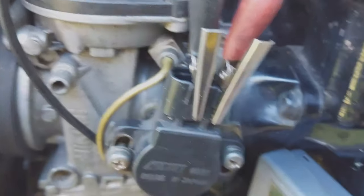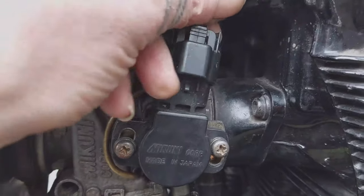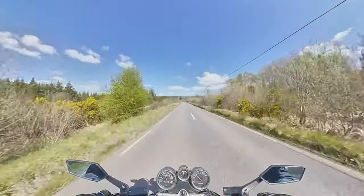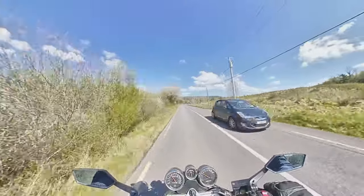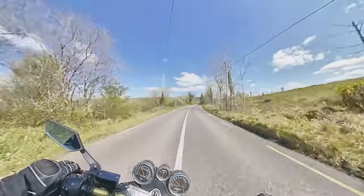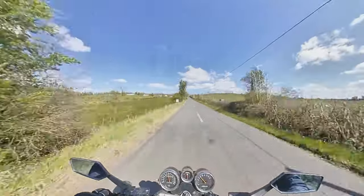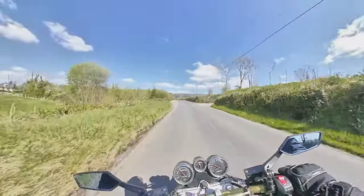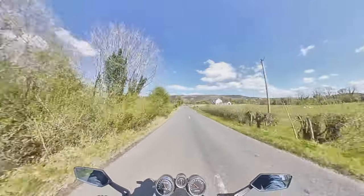That's the measurement across the outer two pins with the throttle wide open — 4.5 kilo-ohms. Once you've got that far with it, all you need to do is plug the cap back in, put the cover back over it, and you're ready to go. That's the process of checking and adjusting your TPS. I hope you get some benefit out of that and it shed some light on the issue. If you find that useful please don't forget to like, comment and subscribe — it's a great encouragement to see likes and people watching. Thank you very much for your time, Emerald Bandit over and out.